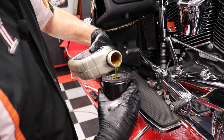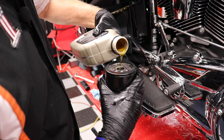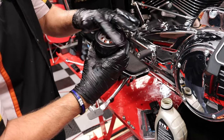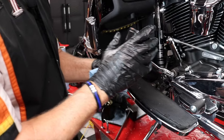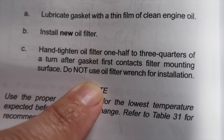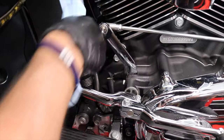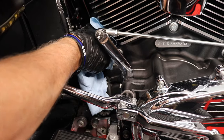Now I'm going to take my new oil filter and fill it about half full with new oil. Some mechanics would tell you it's unnecessary, yet some swear by it — so I always add a little bit. Then I'll lubricate the rubber gasket, which aids in the removal process for the next service. If I don't do this, as the engine goes through its heat cycles, it can make it very difficult to remove next time. Referring to my owner's manual, when the rubber gasket touches the filter housing, turn it one-half to three-quarters of a turn and hand tighten — no filter wrench needed.